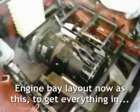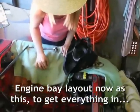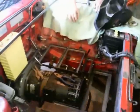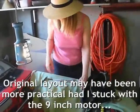But if you have a quick look at the other side there — can you get the camera onto that? As you can see, there's plenty of space for it to actually come down and that just goes up. So we're good. Best use of space as possible, which means breaking it up a little bit. The downside is that there'll be a bit more resistance in the cabling, but the upside is that we've got the battery management and also get some ventilation through the batteries anyway.